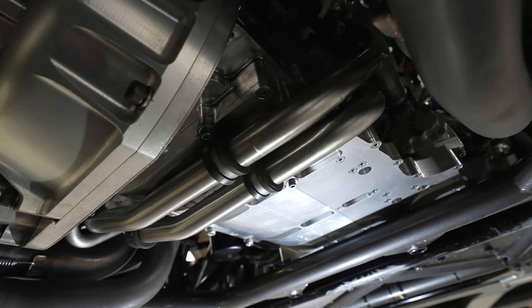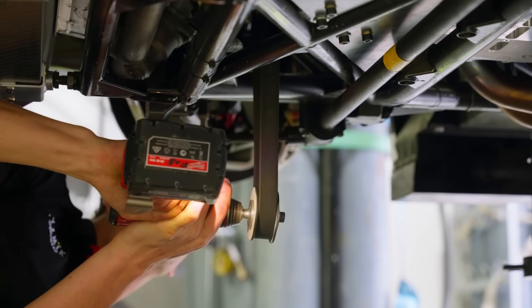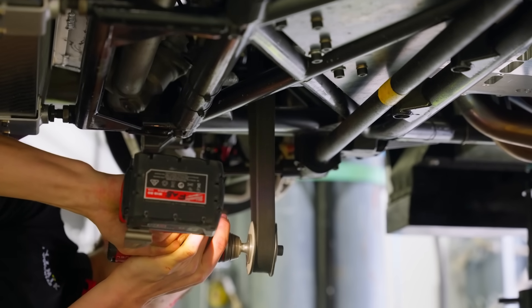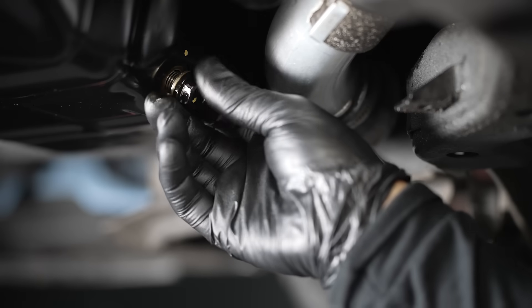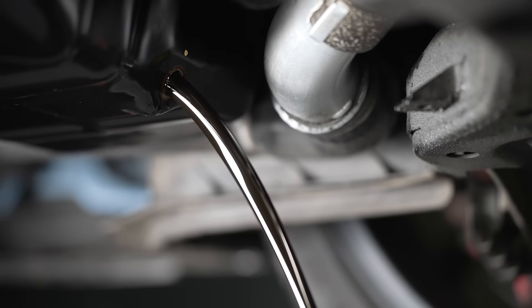For that reason, when you turn the engine off all of the oil sits down in the bottom of the sump, and there's no drain in the sump. So one of the first things we have to do is rotate that oil pump mechanically — that'll take all of the oil out of the sump and put it up into the oil tank, and then the oil tank will drain it out. Whereas with your normal road car you simply just remove the plug out of the sump and drain it out.